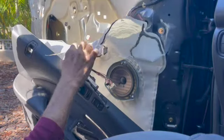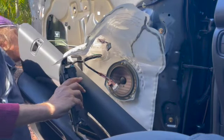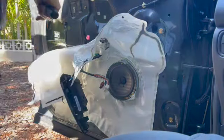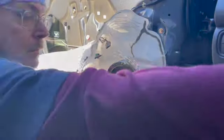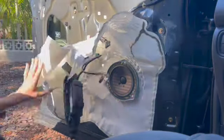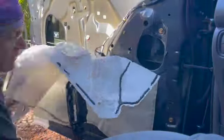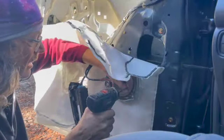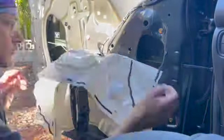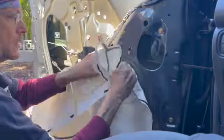Normally I don't take the plastic off, but I did this so you could see what's going on — and to make sure it's the motor. If you're hearing a crunching or grinding sound, that's the cable, so that's obviously the regulator. If it's not making any sound at all, tap it with a hammer and see if that gets it to work — it probably will, it's probably the motor. Either way, you're getting the regulator and motor assembly. Three Phillips screws hold the speaker on — let's get that out of the way. If this is helpful, please hit the like button; that helps other people find it on YouTube.